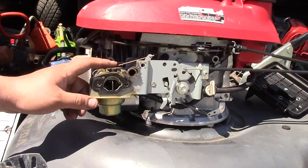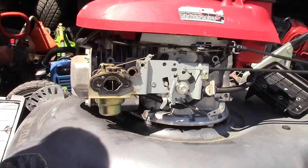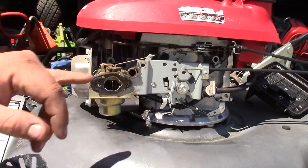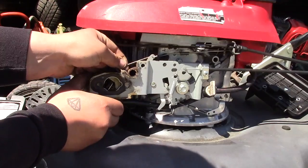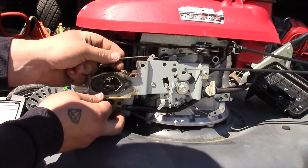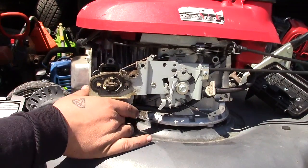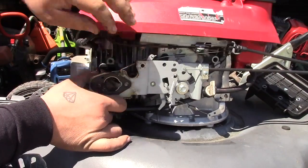Your carburetor is going to have a few linkages hooked up to your choke and your throttle. They can be a bit intimidating at first because everything does look somewhat complicated, but I promise they're not — it's fairly easy. Most of these fittings and linkages just have an S-bend pattern on them and they're quite simple to get off. The carburetor will tilt the way you need it, and you can simply bend this little shield out of the way and disconnect your choke linkage just like that — it is an S-linkage. I like to tuck that over so the linkage cannot fall off from the other side. It's the same style on your throttle: just tilt the carburetor, push back on the linkage, and it will pop out of its hole.